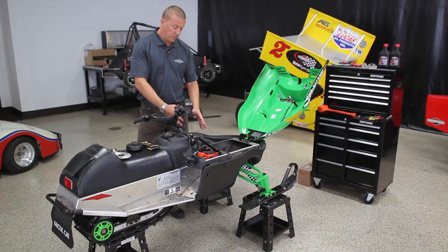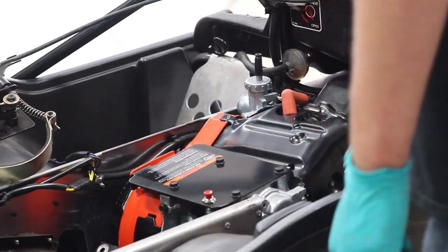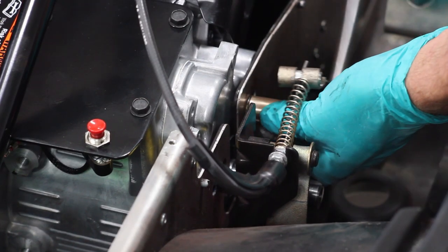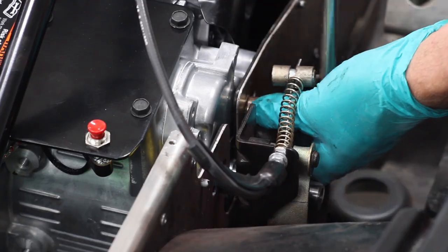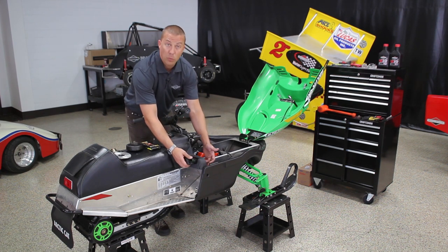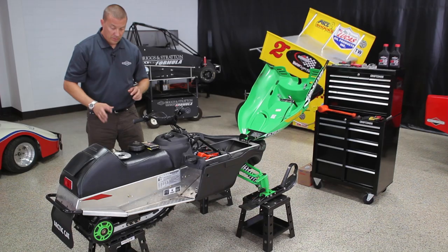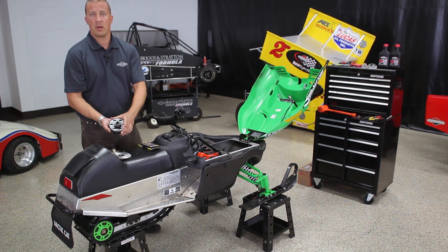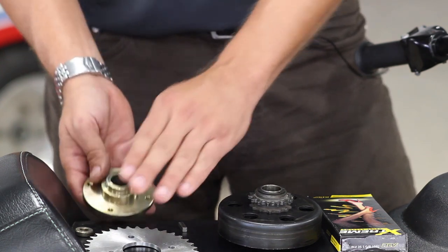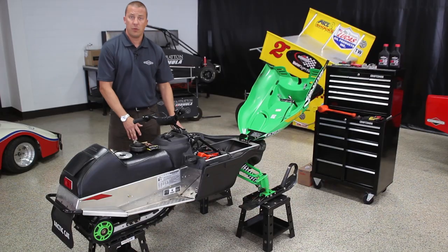Now we've removed the engine. We've taken the 206 engine and dropped it in. We put the motor mount bolts back in place — it's a stock configuration, so there's no modifications outside of refastening it up. Same with the firewall bolts. We put the brake back in place, the chain tensioner is now in place, just reversing out the steps. We've also fished the rewind through and retied the knot. Now we've converted the stock clutch to a 17.2 driver, and we have our aftermarket gear hub for the secondary, our 40 driver, and our chain. We're going to go ahead and redo the drive system.